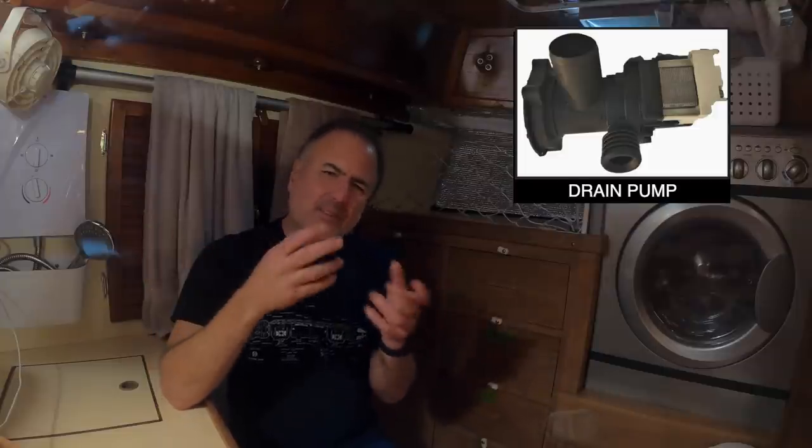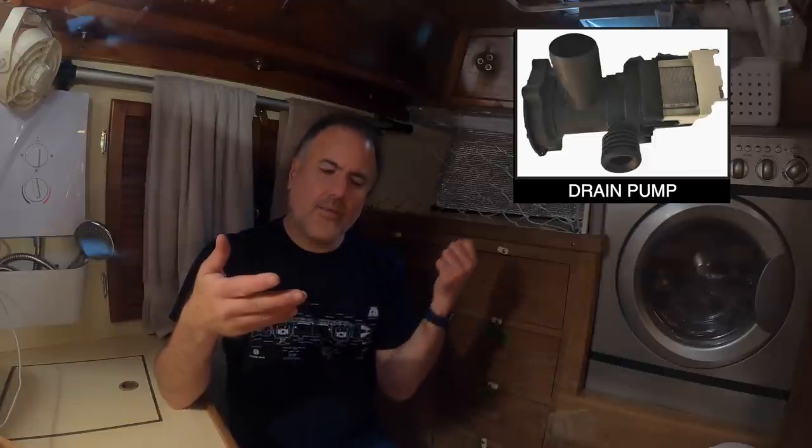One of the things I'm most impressed by is the fact that it's still working even after 12 years of full-time use and thousands of wash cycles — it's been an incredibly reliable machine. There was one time when it stopped draining, so I called Splendid tech support. After some troubleshooting, they suggested the drain pump might have failed, so I ordered a new one. But when I went to replace it, I discovered a little piece of cloth stuck inside the old drain pump. I removed the cloth and it worked fine again, so I didn't need to replace it after all. Now I have a spare in the locker.